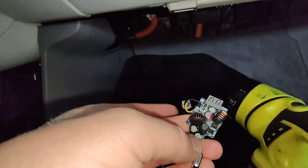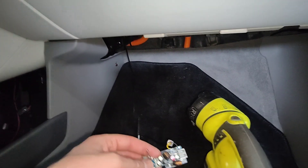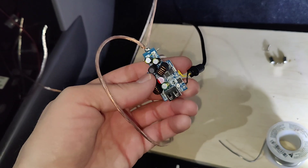I forgot to explain that the wireless Android Auto dongle is going to piggyback power from the dash cam circuit board plug that normally goes into that 12-volt power outlet. Since I'm hard-wiring the dash cam anyway, I figured I'd use the existing USB port on that to also turn the wireless Android Auto dongle on and off. What we're going to do next is solder some wires directly onto this dash cam plug-in power supply circuit board, and those wires will connect to the 12-volt port.